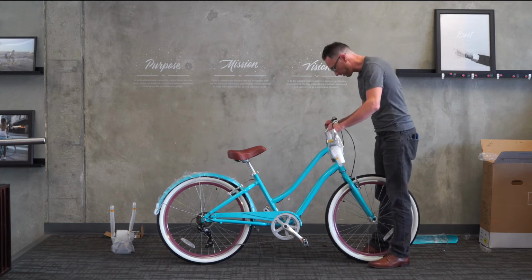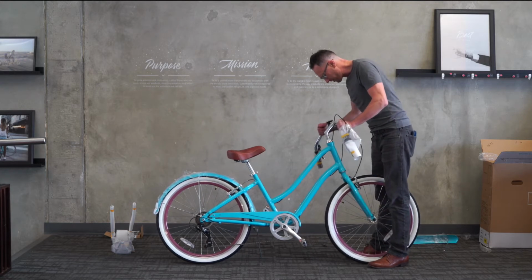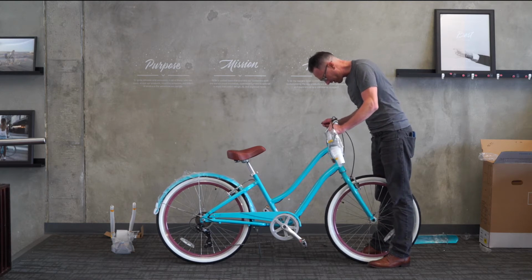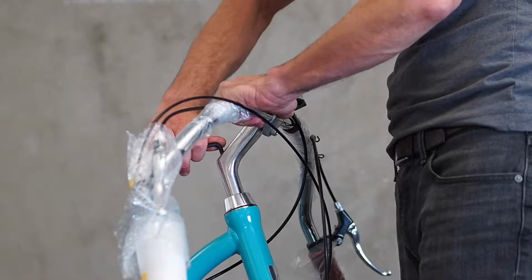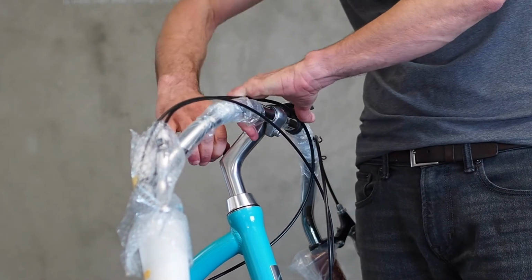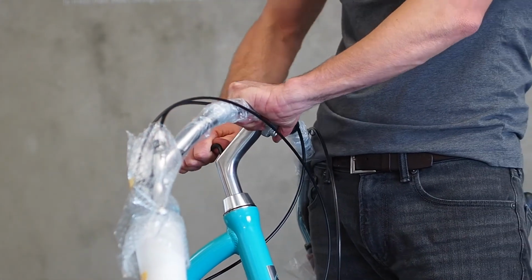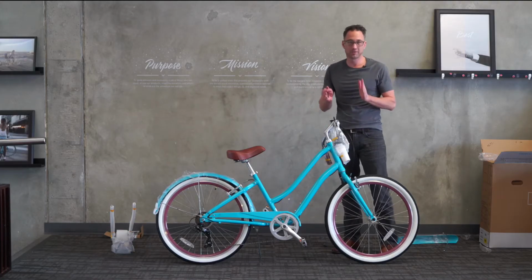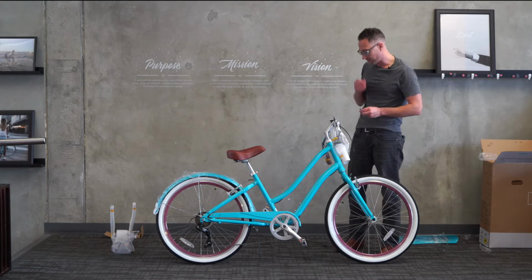Now stand over the wheel and line up the stem so that it is right in alignment with the wheel. Just do your best. You have to eyeball it. It's always a little bit tricky. Sometimes one eye looks a little different than the other, or different people have different feelings about your alignment job. But when you sit on it, see if you like it or not, and if it feels like it needs to go to the left or right, you can adjust accordingly.